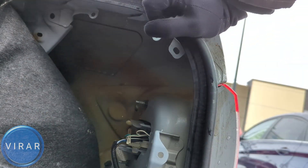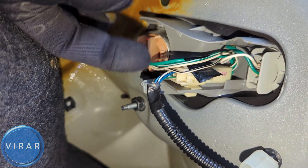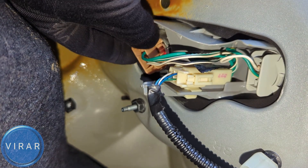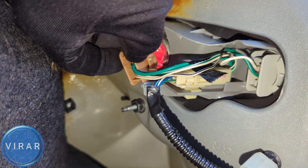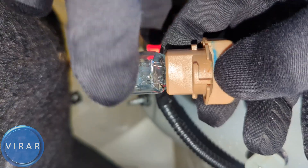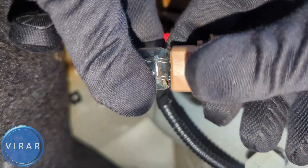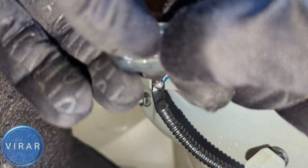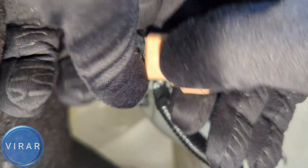Now we can access the bulbs. The orange bulb holder — that's the one. We have to twist it left to loosen it just a little bit, and that's it. Now it's loose. Pull it out and the bulb is right over there. To get the bulb out of the bulb holder, just grab on the bulb and pull it out straight. You will likely have to wiggle the bulb for a few seconds because the bulb is going to be stuck on there, but be patient with it — it comes out eventually.